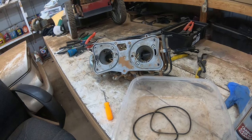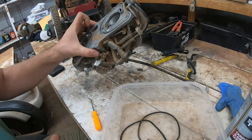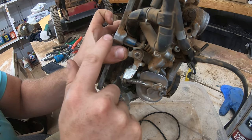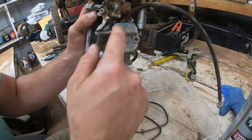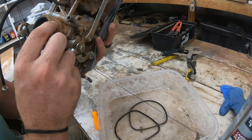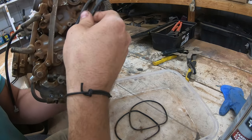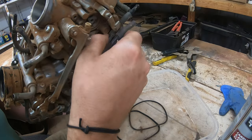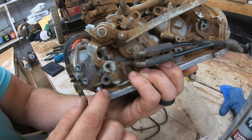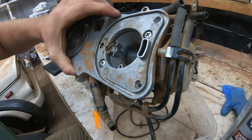Get all your tools ready. I like to have a Tupperware container for rubber gaskets and a few different boxes. As you can see, this carburetor is very dirty and definitely needs cleaning. Everywhere you see a hose there should be a hose clamp — that's where the pliers come in. Big emphasis on 'should be': if you're getting this motorcycle secondhand there's a good chance none of them will be there. The goal of this disassembly is to remove everything that cannot soak in gasoline — rubber diaphragms, rubber gaskets — separating them from the metal.